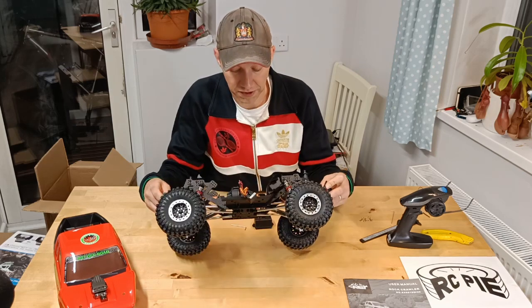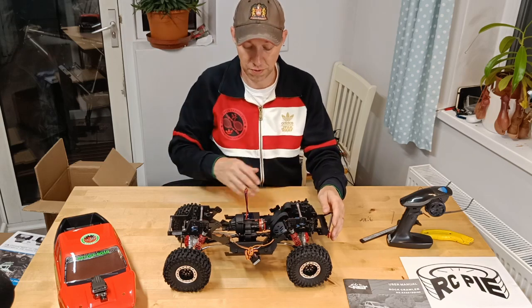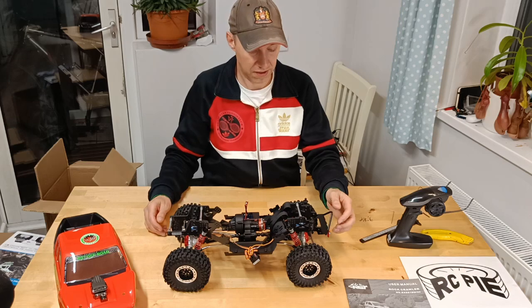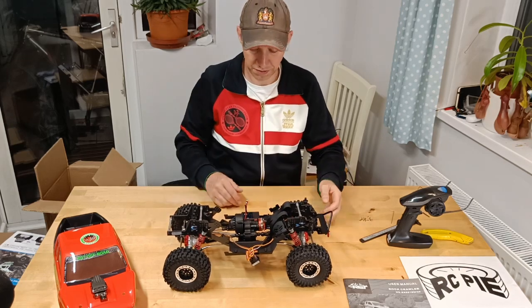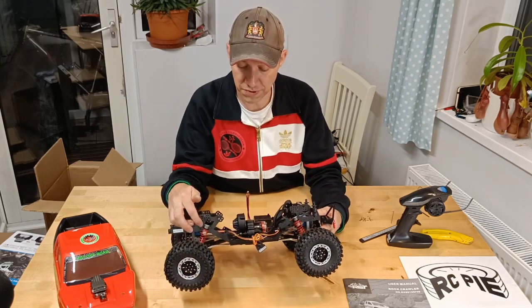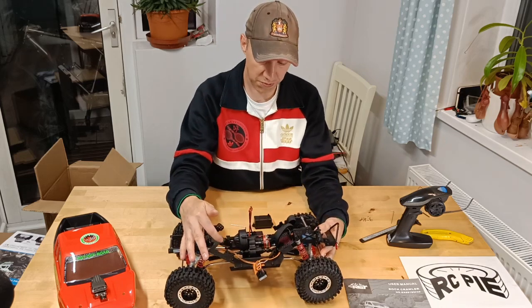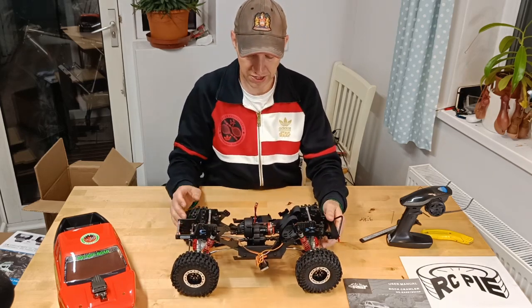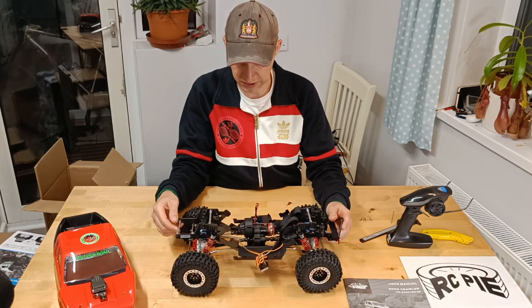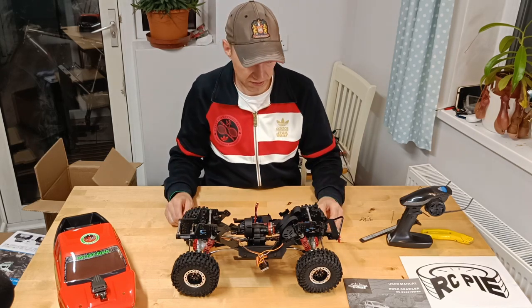So that's definitely going to mean that you've got a bit more forward weight bias with the motor in the middle. That's just going to tip it forward a little bit. And this bumper is probably already taking it forward a little bit. Suspension wise, there's a lot of possible adjustment here. Apart from all these holes here, you've also got more forward ones, so you could really ramp that in, or potentially even change it over to a cantilever setup. I suppose that's possible.